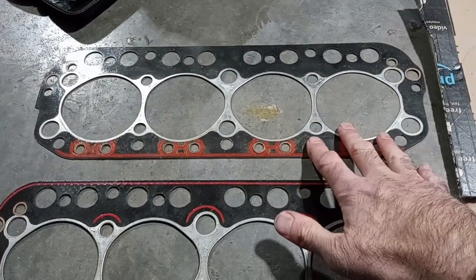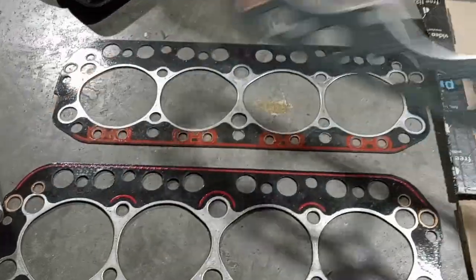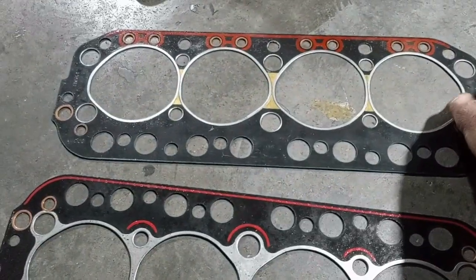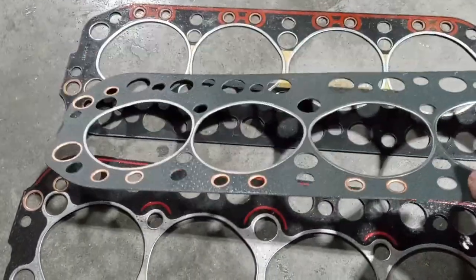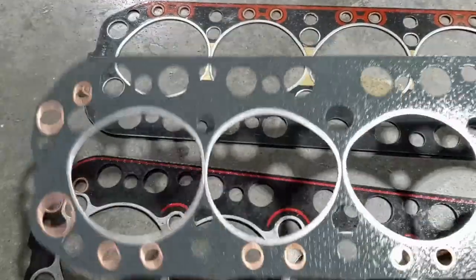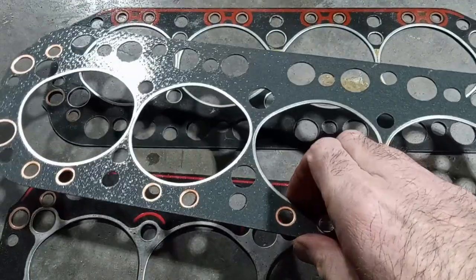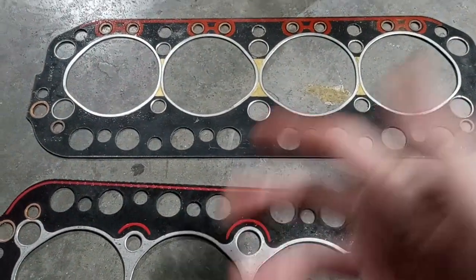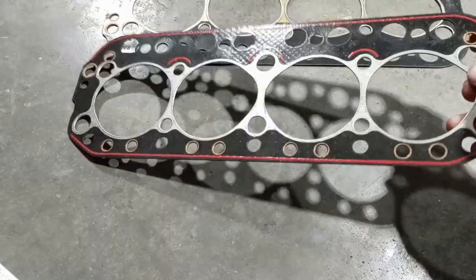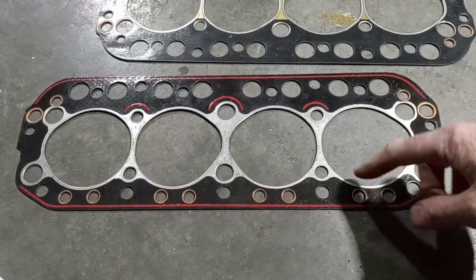The Payen, if it's still available — I think it's back at Moss — hopefully it is this original one and not the Felpro one that does not include all the good features. Update: the Payen AK-660 doesn't seem to be made anymore. I think it's the Felpro as a replacement, owned by Federal Mogul, same company. They've stopped putting the extra silicone in there — it's just a cheaper gasket without that metal. I went to Moss and British Parts Northwest. Moss calls it the Payen gasket but it's the Felpro style, and British Parts Northwest says out of stock for the Payen. So it looks like we're back to the Lucas Heavy Duty. Even though it is a bit thicker and will lower your compression ratio a little bit — which with rubber bumper cars you really can't afford — this looks like the way to go to at least avoid leaks.